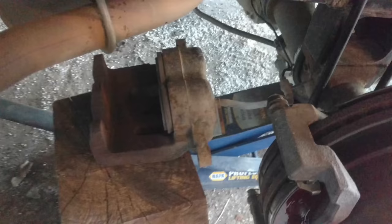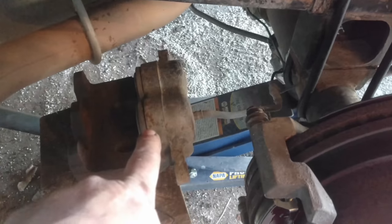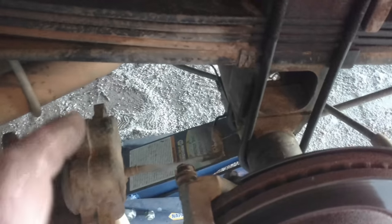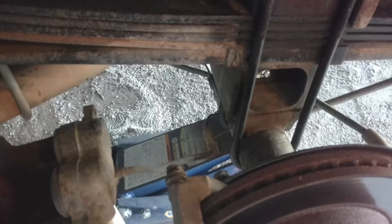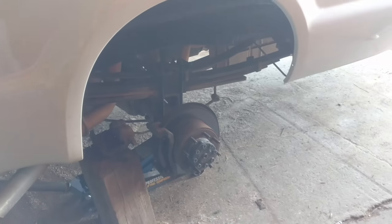This is all ready to go and we're going to put it back into place. This probably goes without saying, but don't ever hang your caliper by the hose — it will literally tear apart, maybe not then and there, but probably in a panic stop when you're trying to hit the brakes good and hard. Anyway, we're ready to go back together, put the caliper on, get the wheel on, do the same thing on the other side, and go from there.